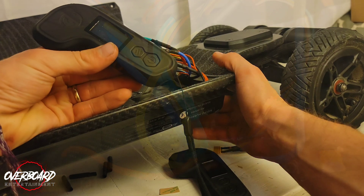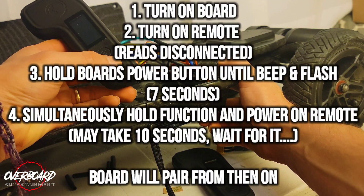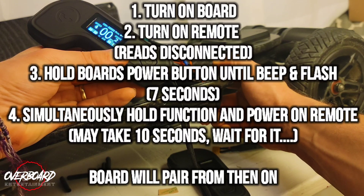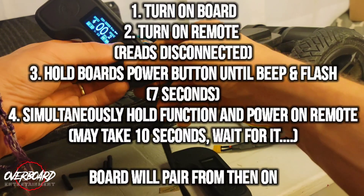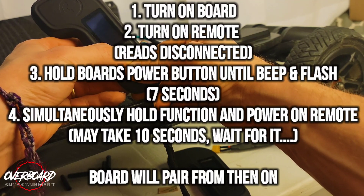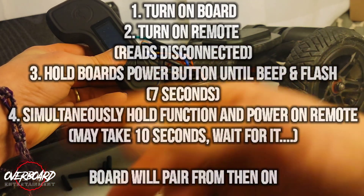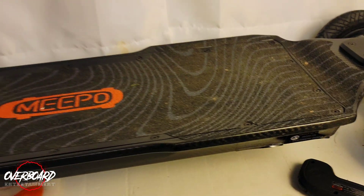That is changing your ESC. To get the remote paired: turn the board on, turn the remote on. What you'll do is hold the start button on the board for seven seconds — you'll hear a beep and it'll start flashing. Then simultaneously hold the button on the remote and it'll shut off, but it will tell you it's paired. Once it's paired it'll be automatic, and from that point on you'll be able to turn your board on by remote as long as you kick your board as you're supposed to. Motor wires rewrapped — black tape will do fine. Get those last 16 bolts put in and you are done. If you have any questions, just drop a comment below.